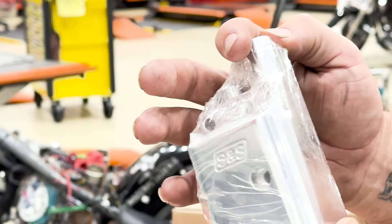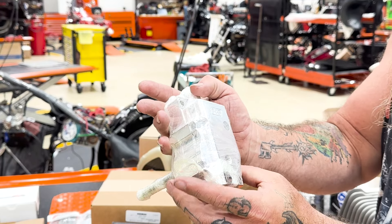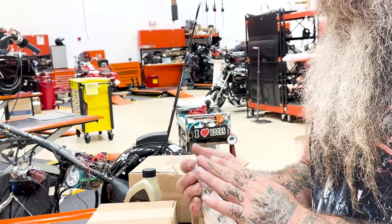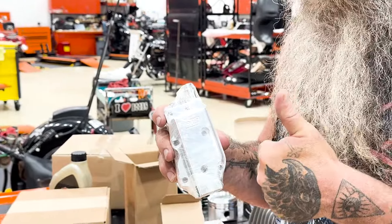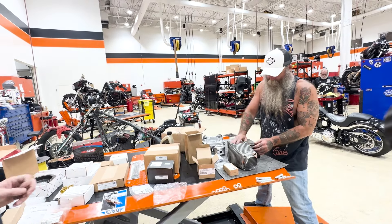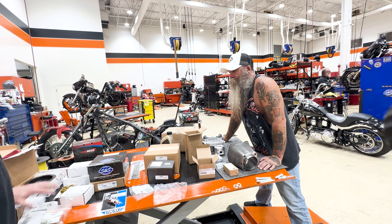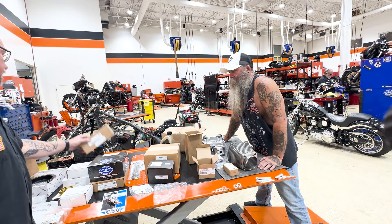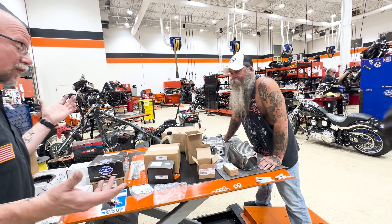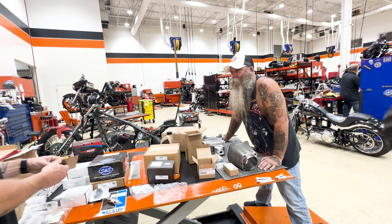Isn't that pretty? That's what I'm talking about. That was a big problem with Maxwell House — the pump, lack of flow. We had all the flow going nowhere. Look how pretty that is. Super exciting — and a bunch of keepers, and that little deal with the half-moon key and bolts. That's another good piece by S&S. Then of course we have the stator and the comp pieces, the regulator we talked about. It wasn't charging because there were pieces missing and it was burnt — the electrical was about to just go down and burn up.